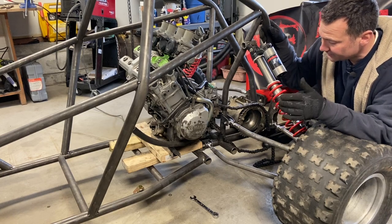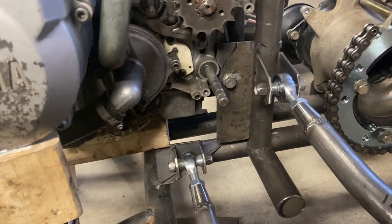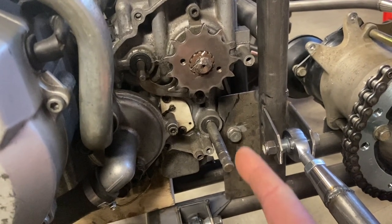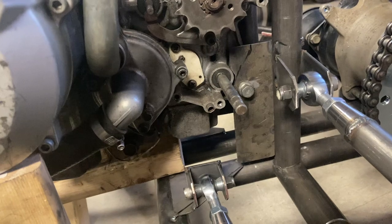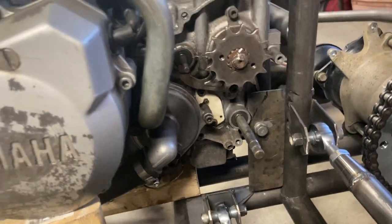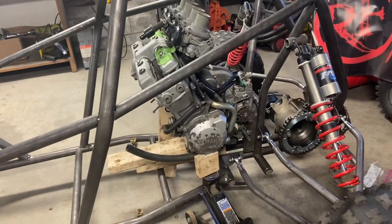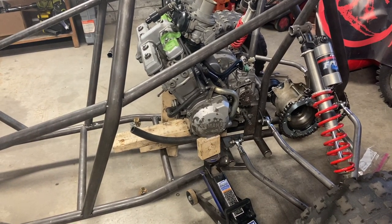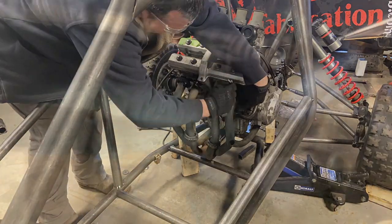Here's a close-up: this is just the rear tab that I tacked in three places, and the bolt is running all the way through — this is the rear motor mount bolt. There's a gap at the bottom because I had to raise it to make clearance for the exhaust. I'll make new brackets if I want to triangulate that. We can put the motor on a pivot from the rear and then start test fitting the exhaust. Once the exhaust is test fitted, we can make the front mounts.